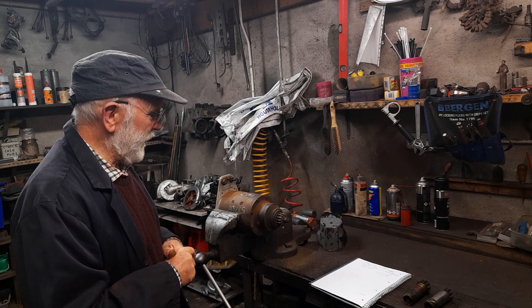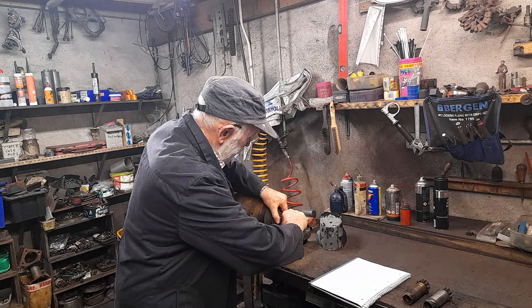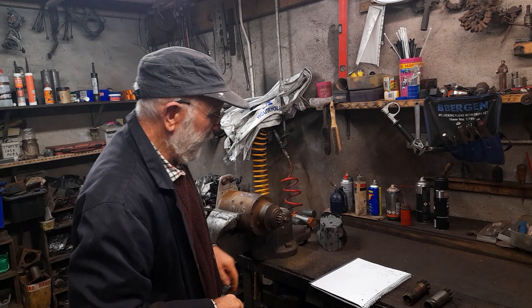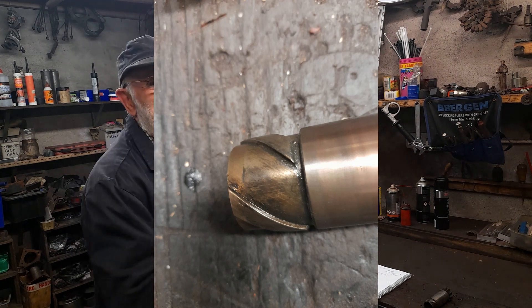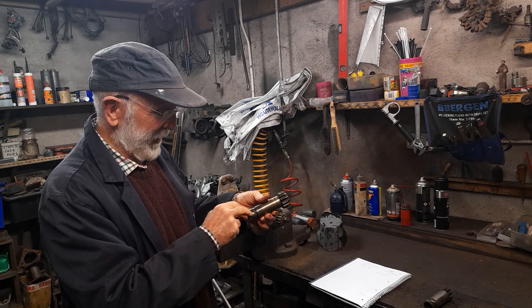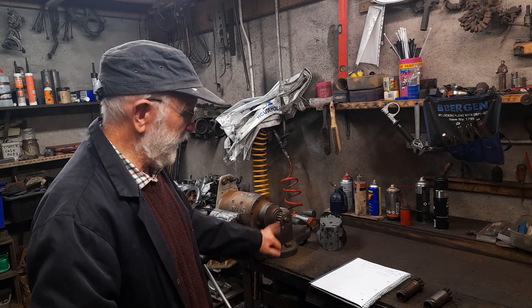The other thing I wanted to point out is that the two nuts at the front here are not tight against the pinion. If I hold that nut I can turn the pinion independent of the central shaft — this is really quite important. The pinion itself has a helical drive on it, which means that if the engine happens to backfire it can't turn the pinion back in the opposite direction because of that helix. The clutches inside will also protect the starter and the pinion teeth from being overloaded and stripping the teeth off.